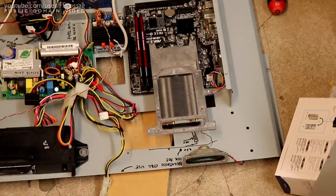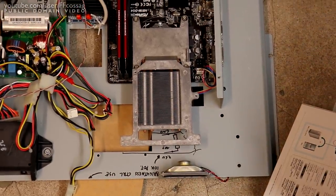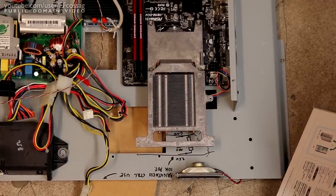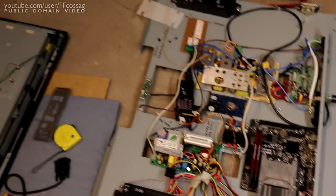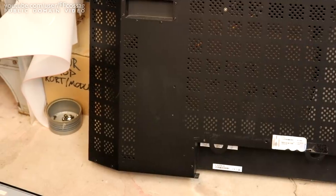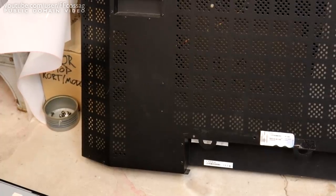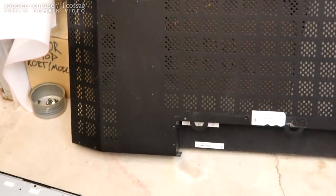The motherboard fits just fine. You can see the hole for the hard drive cage does not quite line up with the heatsink, so my plan is to drill a bunch of holes underneath where the fan goes to give it a bit of an easier time. It does provide decent cooling even though it's just lying flat on the surface, but due to the layout of the back of the case the fan is probably going to be exhausting out against pretty solid metal, so it won't have super good flow on the exhaust side. Might have to drill a few holes there as well.